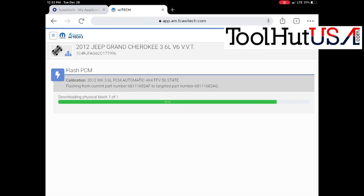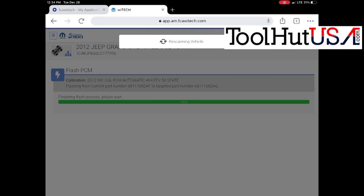One of the things you always do after you program a PCM on any vehicle, in my opinion, is make sure the transmission and any other powertrain control modules — whether it's a transfer case module or anything to do with the powertrain, transmission, or transfer case — have a current calibration in them. It did ask you to turn the key off here, and Chrysler is pretty good about setting a timer and then telling you to turn the key back on. At this point the vehicle will not start, so do not try to start it.